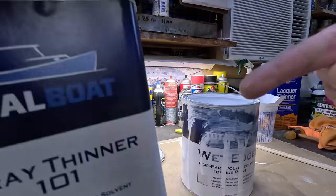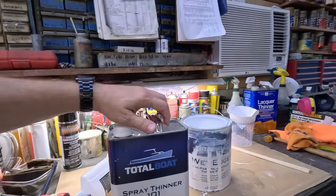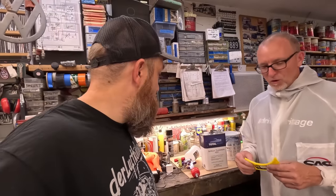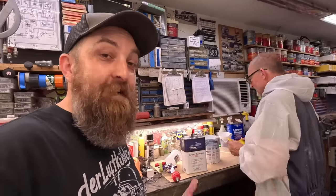And that comes with a thinner that we're spraying, which we think is just xylene, because that's what the can said. It just said you thin it with xylene. So 5-1 is our ratio. Very happy with how it sprayed. It had a good consistency. And Martin showed me a new gadget, these things, so he's not spilling paint everywhere.